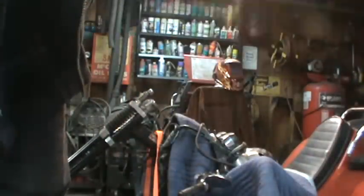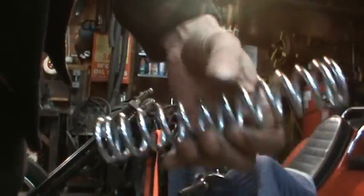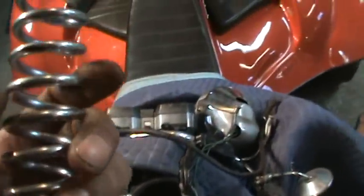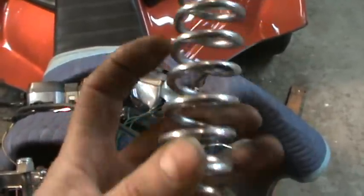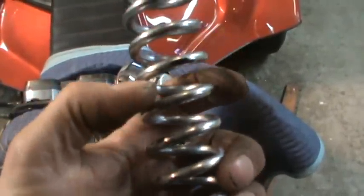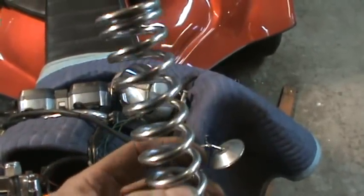That's the spring we're going to go with. We're going to cut it in half and those should be my upper preload - eight inches long, I'll come down to two four-inch pieces. But then I have to be able to make one side look like the end in the middle, so I'm going to try heating it up and see if I can bend one rung down to touch the other one. I'll bring it back after I get that made up.